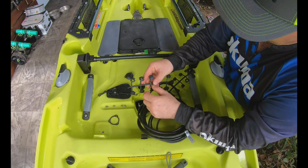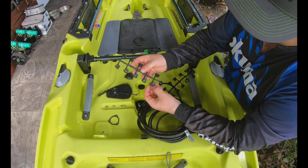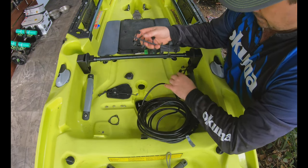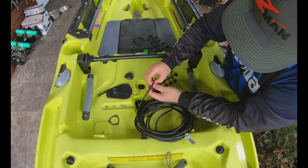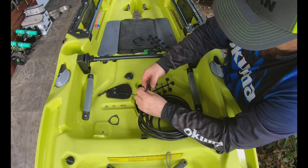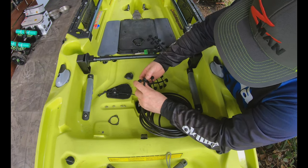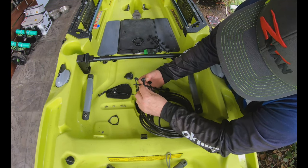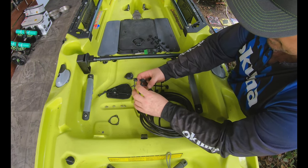You can see there's a couple of different grommet sizes. The larger ones would be for your power cables and stuff like that. What we're very interested in is these smaller ones, and what we're looking for is a snug fit. See there - that's not going to be a snug fit, it's going to allow water to get through. I'll try this grommet over here - I reckon that one's going to be on the money. See that it's a nice snug fit and the risk of getting water in there is going to be quite low. So that's the one we're going to go for.